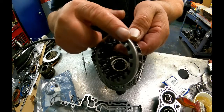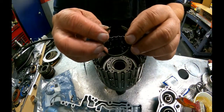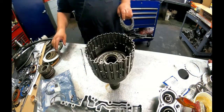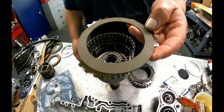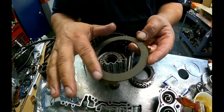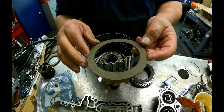And with this side of our return spring to go down, short end of the taper up again. All right. I take one of these clutches here. I keep all the old ones. And I buff the clutch lining off with a Scotch-Brite pad and angle grinder.